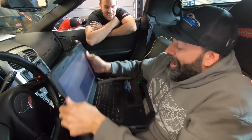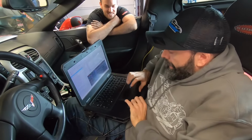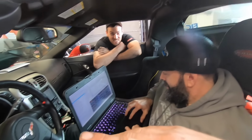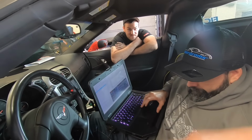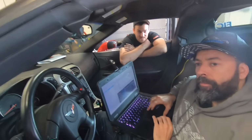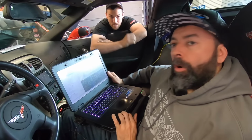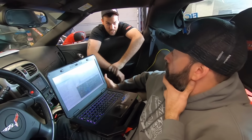All right, so boost-wise, that looks like our 4.8 just ate 700 in the first gear. We might not have to touch a thing. Boost-wise, we might be able to just leave the same springs, because I bet in second gear it picks up some serious boost. Do we have an idea what the compression ratio is on this thing? Yes. Let me call McFarland Machining.